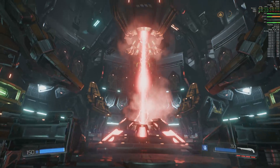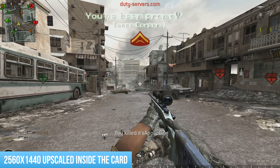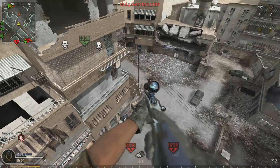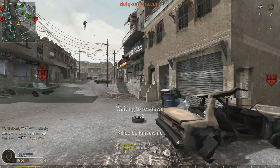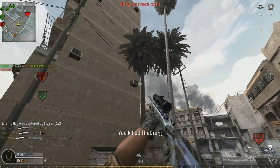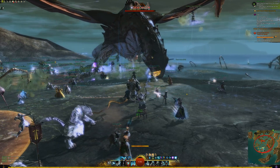What's even cooler is if I run a game at a non-native resolution across the 4K signal, it still handles it just fine — it looks like it's recording the raw feed that my monitor gets. When you switch games running below native resolution and alt-tab, it'll resize the desktop momentarily, and it recorded every frame of that instead of just going black like an Elgato normally does, which was really cool to see. Their software lets you configure the inputs however you like — customize the bandwidth of specific ports and even the frequency timings of the DisplayPort signal. You do have to play with the color space settings in OBS sometimes to get it to show up correctly, and sometimes it'll even show up upside down depending on which setting you have. But it works flawlessly with barely any system load once recording from a separate computer.